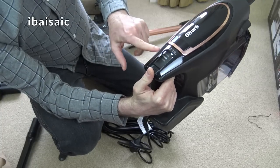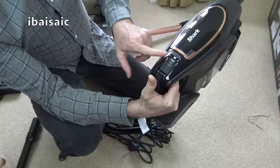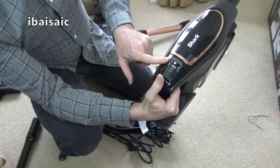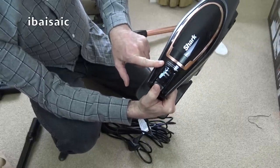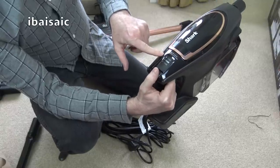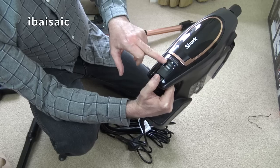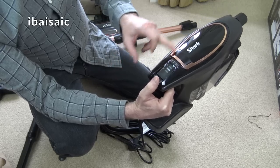You have off, setting one which is for your hard floors and area rugs, and setting two for thick pile and carpets. That just changes the speed of the power head — on thick pile carpets it goes at the faster speed, and on your hard floors and lightweight rugs it rotates slower.